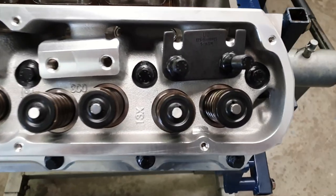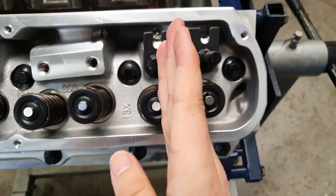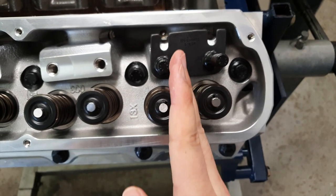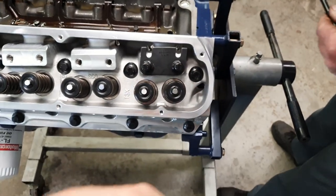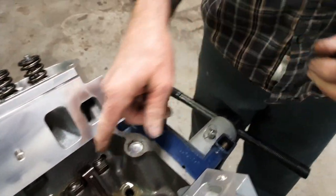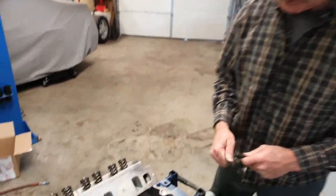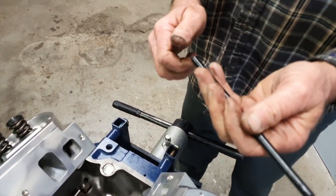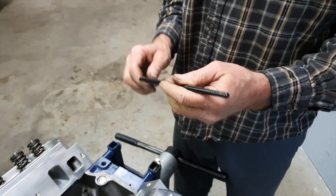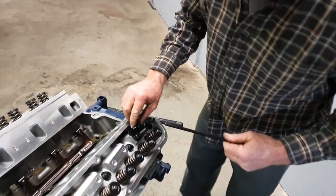What you're looking for — trying to angle this right here perfectly — you want to eyeball it and make sure that the geometry looking right here is pretty even. These are pretty easy to adjust because they're one-piece and the holes have really tight tolerances. Here's the push rods — it's always good to lube the ends up. Also, just another note: these lifters are all brand new, soaked in oil overnight, so they're totally filled and already have lubrication. You can put bearing break-in lube on there if you want, but we typically just put oil on it unless it's a race motor.